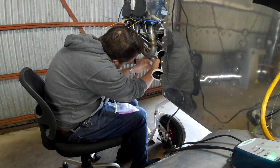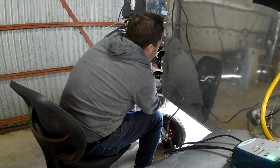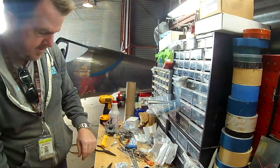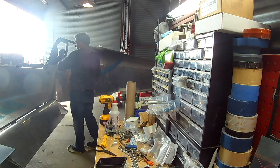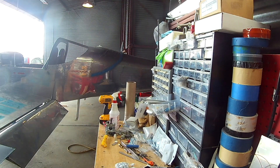What we're going to do is take the sensor apart, because you can just buy an oxygen sensor. They really don't make them for Lycoming because this is not a thing. Mine's off of a Chrysler — it's a Bosch O2 sensor, and it's a 5-wire sensor. What that means: there's two wires for the heat, one for the signal, and one signal ground, because this thing is making its own voltage and it's not regulated, so you use a signal ground to make sure the signal's clean. In our case, we ground it directly to the number one battery. And then there's a fifth wire that you don't use. Unfortunately, there's no color code anywhere on the Internet I could find, so I'm going to investigate and figure out which wire is which.